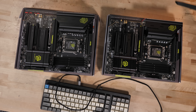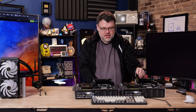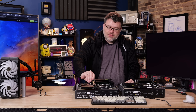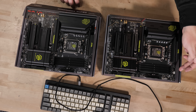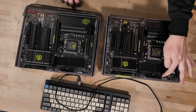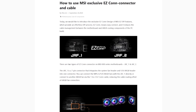The physical layout of these motherboards is almost identical. One difference is the thinner M.2 heatsink on the B850 — it doesn't matter if you use an M.2 with a built-in heatsink, like the Gen 5 Crucial T705. The X870E heatsink is slightly thicker with a little more metal. Around the board: dual 8-pin CPU power, three 4-pin fan headers at the top, another 4-pin fan header at the front edge, a digital ARGB header, diagnostic LEDs, and the X870E also has a diagnostic code readout. There's a 24-pin power connector and the MSI Easy Connector for fans and accessories.